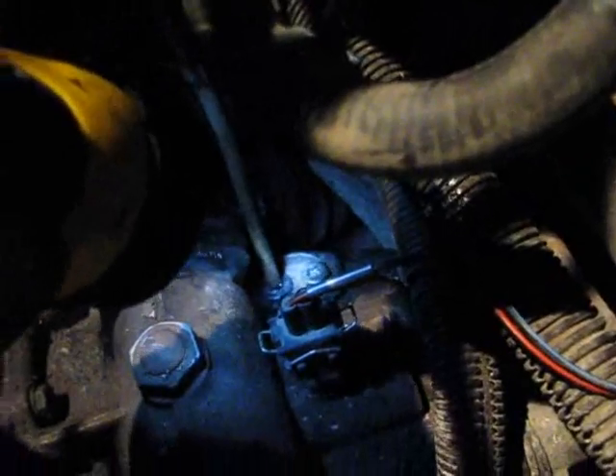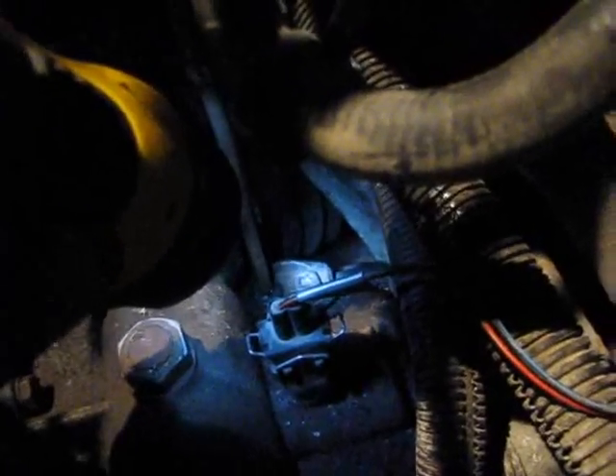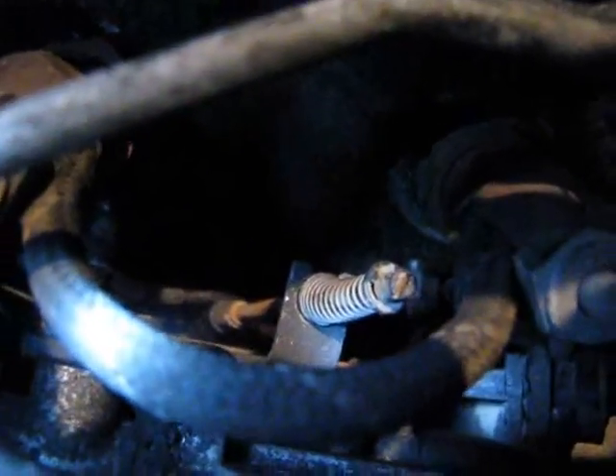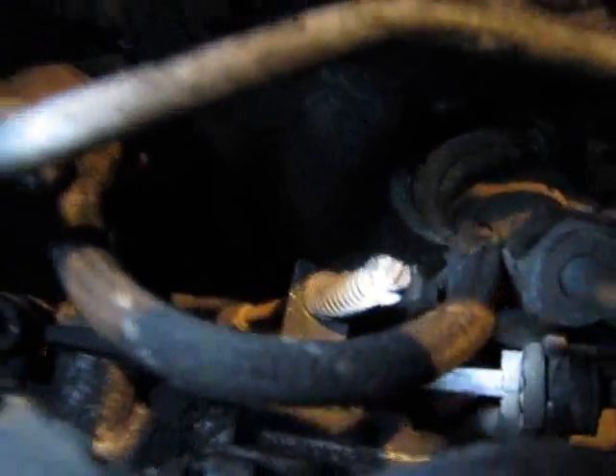I got the speed sensor back in — that guy was a bit of a pig to get in. I couldn't even thread the bolt in, so I had to tap it down until it sat and then stick the bolt in. I got that plug on, I got the throttle cable on — had to adjust it one notch. I found out this guy here has a little washer dongle thing that needs to get clicked on. I had it above it and couldn't pull that cable all the way, and I accidentally bent it down and re-bent it as good as I could.